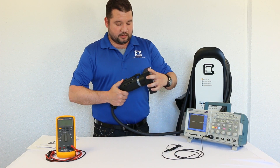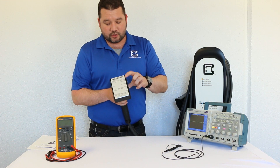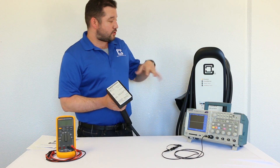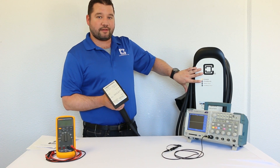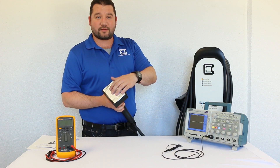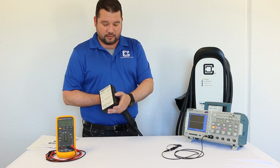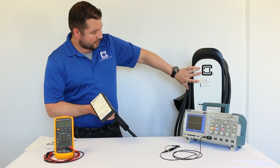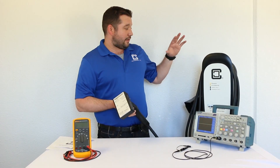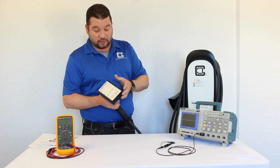I'm going to go ahead and plug it in, and then switch from charge not requested to charge requested. When I do that, we should hear a click and we should see the green charging light on the EVSE come on. There's also a red light on the side that will turn on to indicate that power is being made available to the CP50 from the EVSE. We've got a click, we've got the green charging light on, and we have the red light on. The EVSE has passed the test — it's properly responding to a vehicle's request for charge.